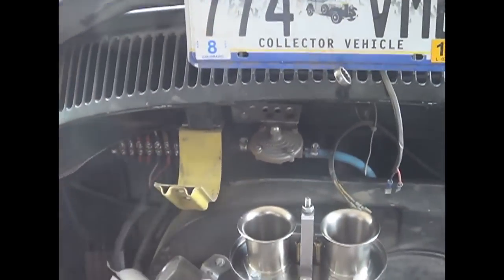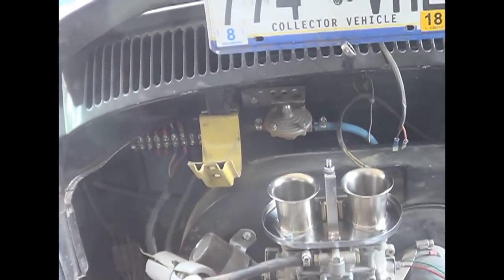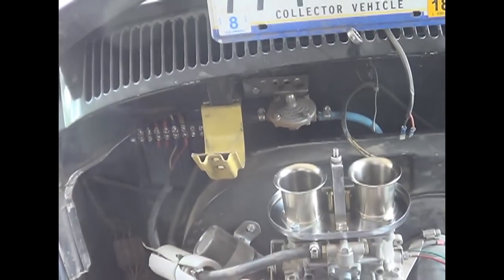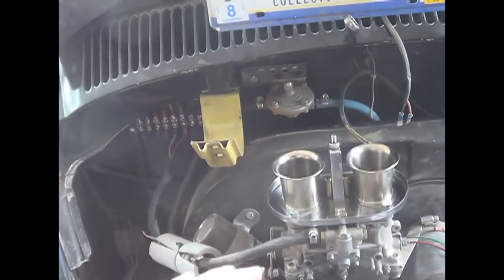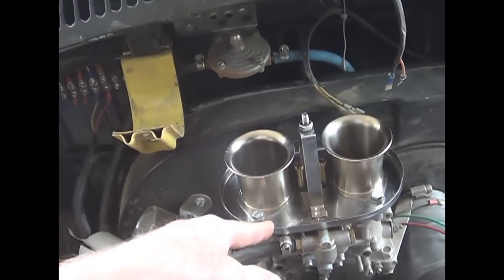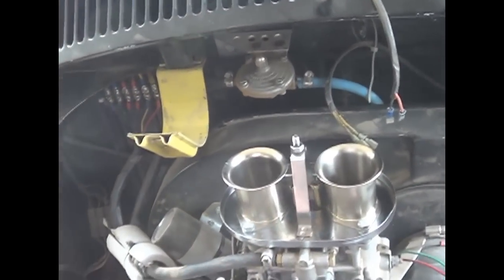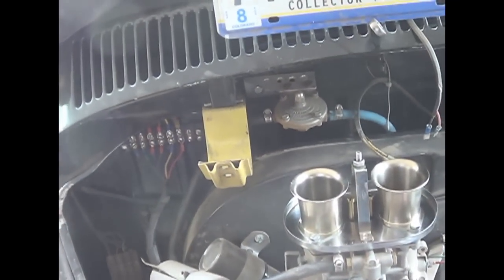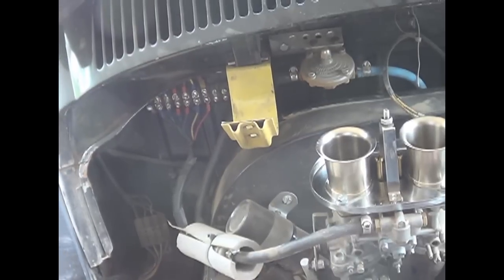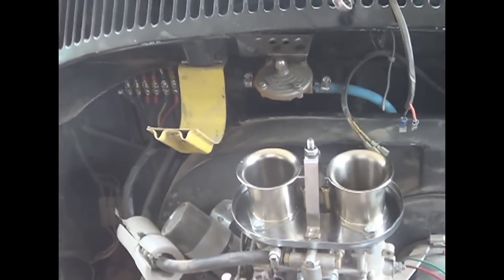This thing has been a literal nightmare, because what the book calls out, and they tell you right up front, is you're asking way more of this carburetor than it was ever engineered or designed for. You're asking it to handle all four cylinders. And you say, well, it's not any different than Cadrons. You've got Cadrons with 28 Venturis, and here you just got the same thing closer together. You're sharing one float. Well, I'm sorry. It wasn't designed that way. It doesn't work that way. It tells you right in the book it was made for smaller engines. And that transition circuit, if you fatten it up, if you want to run a fat engine, okay, and this, here's another point.